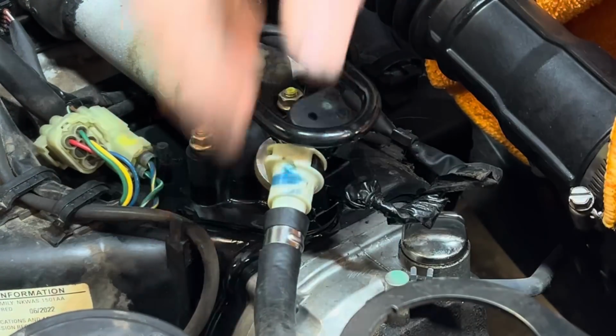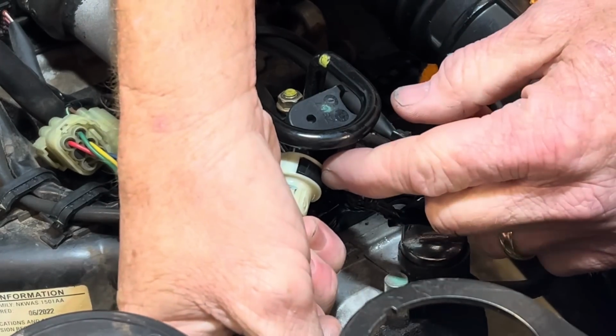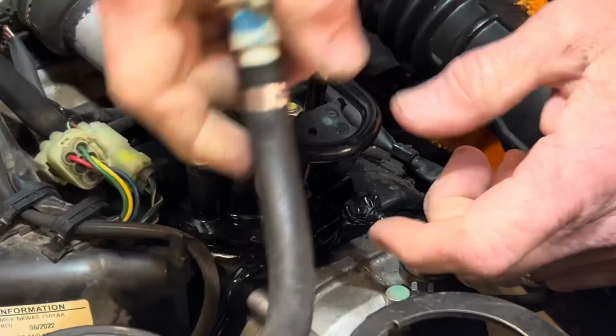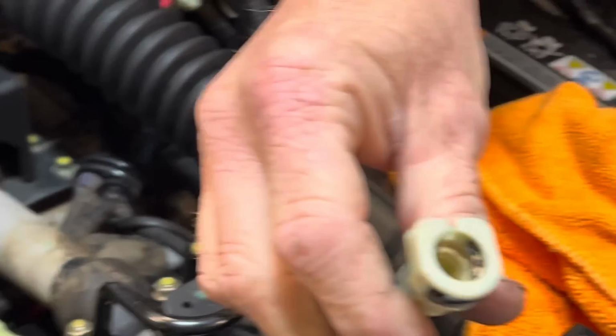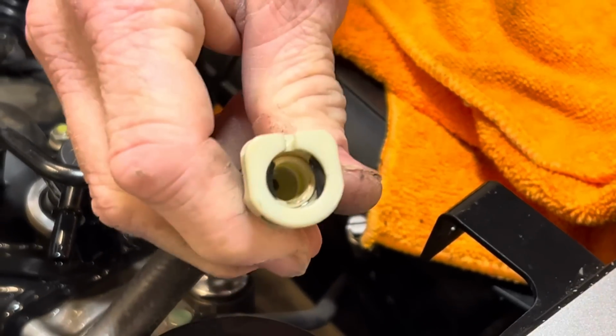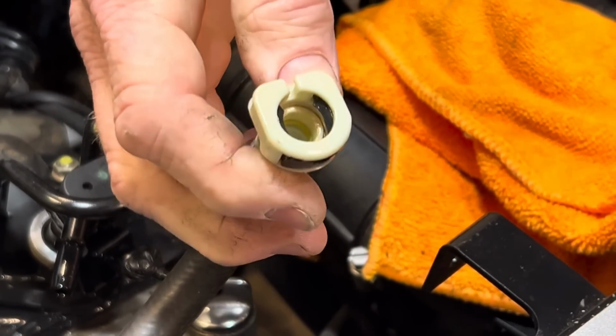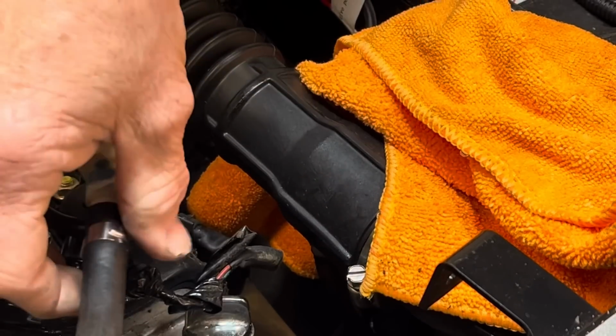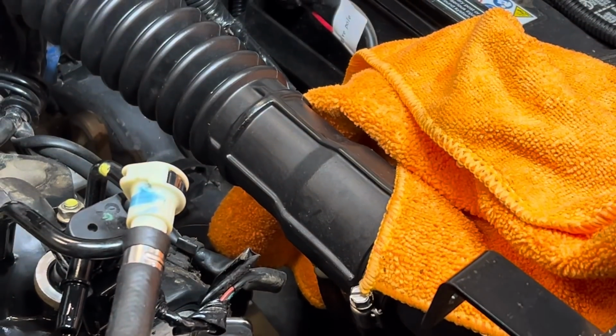So what I'm gonna do is push this button in right here. Now this is the EZGO EX1 engine. A little quiet engine. They're good because they're quiet. And you can see inside there should be an O-ring in the injector rail there. In the hose line, there's not one there. So what I'm gonna do is get one, and we're gonna put it on and see what it does.